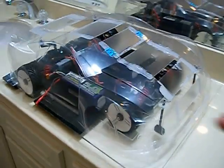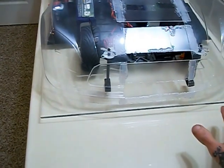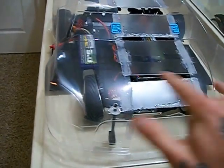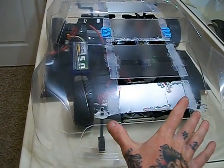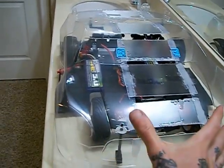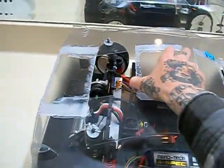This is what I got. This is a ProLine GT8 body. This chassis I'm making is out of Plexi — about 18 inches wide and I believe 36 inches long. In order to fit that GT8 body on there and keep all the wheels underneath the body nice and tucked under to help with aerodynamics, I had to expand it. I split it down the middle and braced it, extending it about 5 to 6 inches outward. The body's a little crude right now but it's got a lot more to go — it's going to look really nice once I'm done.